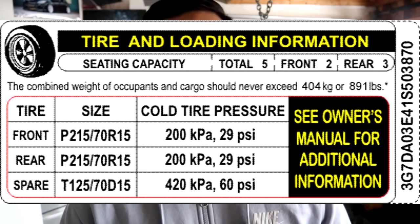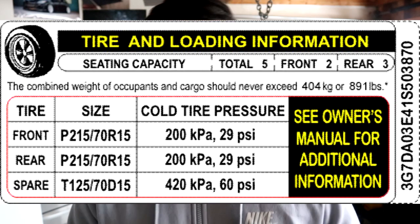That's why we need a system that would remind you, the driver, that maybe your tires are low or also over-inflated, because neither are good for your tires. If you want to know what your tire pressure should be at, you want to check your driver's door — the manufacturer puts a sticker in there called a tire placard.